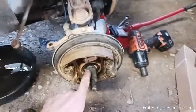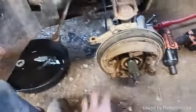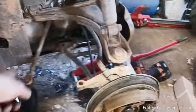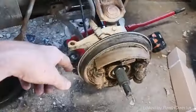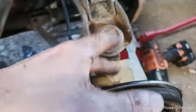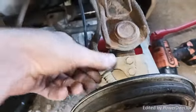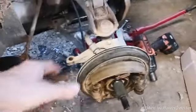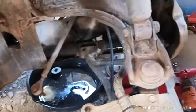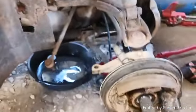So, like I said, just pop that axle out. You press this all the way down. You have to kind of finagle it. I ended up going all the way down and to the side here, and it popped out. You have to work it a little bit, but as you can tell, the axle is in. Everything is like it should be. Just got to put the tie rod back in here and tighten up this ball joint. And I do recommend, instead of fighting this brake line right here, taking these two 10mm bolts out, which will relieve that bracket, which will relieve the tension and let you push it down further to be able to get it out. So you will lose a little bit, probably a lot of fluid out of that, so just have a drain pan ready if you have not drained it already. But yeah, let's do the other side.